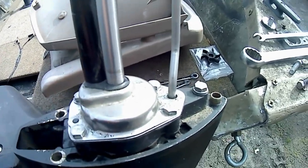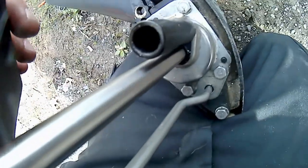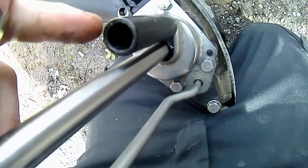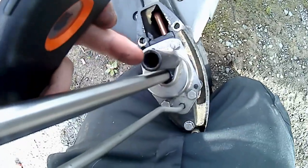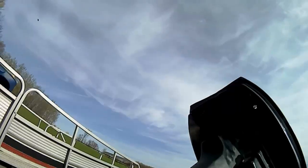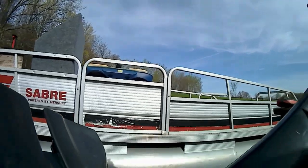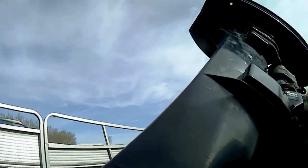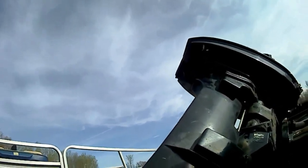It's ready to go back in. You want to make sure that that little copper hose goes into this little tube — that's where your water shoots up into your motor, so it's very important to line that up when it gets to that point. Now we're going to line up that copper hose. They're in — the unit slid up.